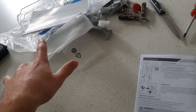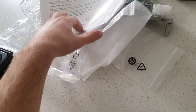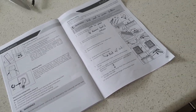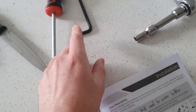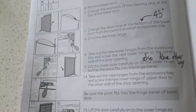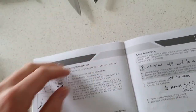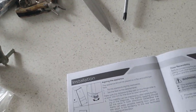You should have some stuff that came with the fridge, which includes an instruction manual and also a bunch of spare hinge pieces for flipping. In order to get this done I needed a wrench — this is an 8mm — a little attachment, an allen key, a screwdriver, and a knife for getting the blanking plugs off. I'd never heard that term before, but they're those little flat cover things for where the screws go in. Pliers also came in handy for taking off some coverings.